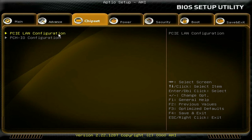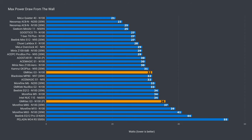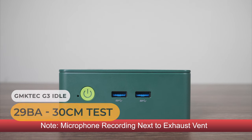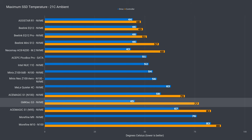The G3 does support wake on LAN and auto power on. The G3 draws more power at idle than most of the other N100 minis I've tested, which also extends to the max power draw — it's a bit higher than most. Max CPU temperature depends on which power mode you use and holds up decently in both. While the GMKTEC G3 is a quiet mini PC at idle, that's not the case under load compared to the competition. The fan ramps up and down quite often instead of having a more stable RPM. Even though there isn't a heatsink on the included NVMe drive, the SSD didn't thermal throttle during my thrash test. While this temp is on the higher side, it's not as much of an issue as it was with the Morefine M9.